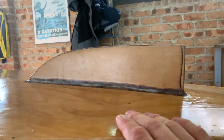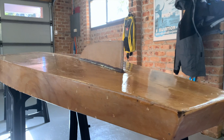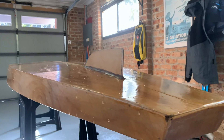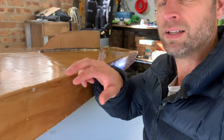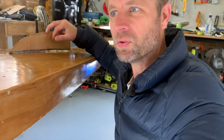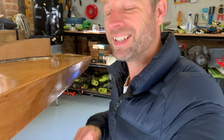I get heaps of comments about this fin — so many comments saying it's going to give no directional stability, it's too small, it's going to snap off. But it's actually worked really well. I don't have any problems tracking straight when I want to go straight. And when I want to turn, I can lean this up onto its hard chines and it will turn in the direction I want. So for all the people who haven't built this up yet, definitely consider adding one of these fins. Shallow draft and gives great tracking — to all the naysayers, it does work.